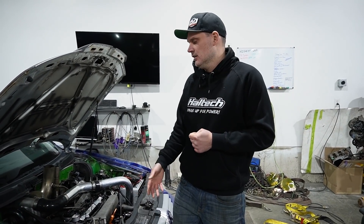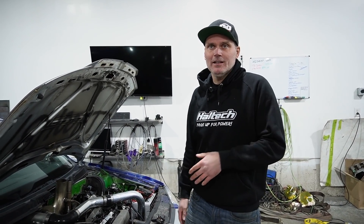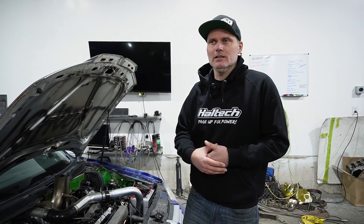And one that most people may not have thought of — I'm to the point now with boost that we're potentially going to compromise the head gasket. Stock head bolts, stock gasket — the gaskets are fine usually, it's just the clamping force between the head and the block. Using stock head bolts, we're already at 40 pounds of boost. We have another three or four pounds of boost to go on the map sensor on the ECU safely. So we could just torch a head gasket and we don't even get to break it. I hope we get to the point where we've exceeded the limits of the connecting rods. Torching a head gasket isn't going to be fun or very exciting.